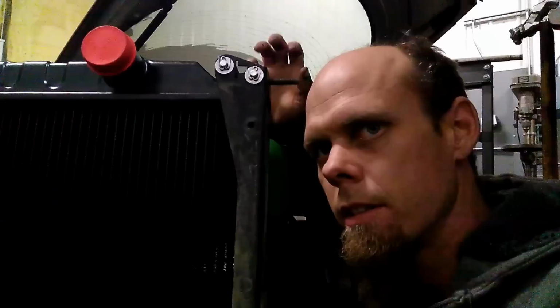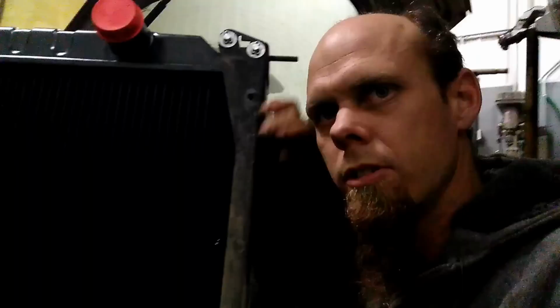It fits. Remember, I mentioned that the three row versus two row was a little bit deceptive. The factory radiator was a two row radiator. The core on this one is actually about a 16th of an inch thinner. Basically, the factory radiator used two wider rows, whereas this radiator uses three narrower rows.